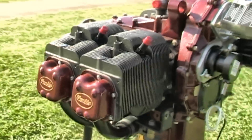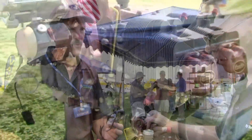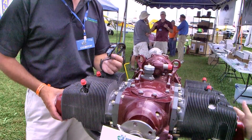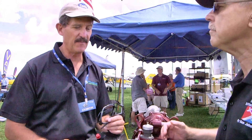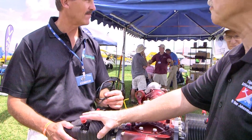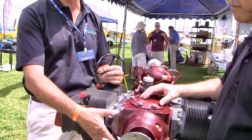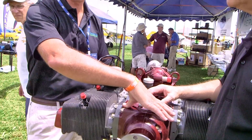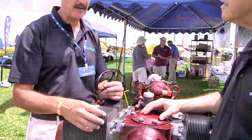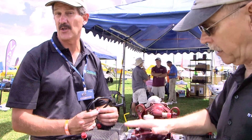This engine is a little more distinctive than more modern engines in that it is an aluminum cylinder with no separate head. So you cannot have a head separation, which happens from time to time. This component I've got my hand on right here — this is all aluminum, one solid chunk, with a steel insert. And it's sleeved, so when overhaul time comes you take this off — it's not through-bolts either, which can cause torquing issues on an overhaul. They're just bolted into the block. You heat it up, slide the sleeve out, put the new one in, re-bore it, and you've got a new cylinder again. It's very economical in terms of overhaul.